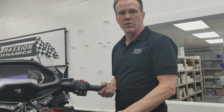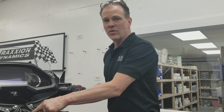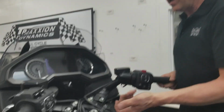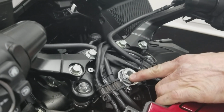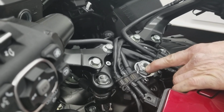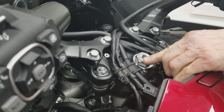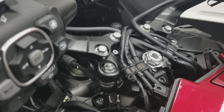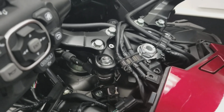This is what you'd have to do if you were not able to torque this crown nut. You'll see what we did here if you want to come closer. We got it as tight as it will go with a common 1/2-inch drive ratchet in the hand. And then we just put some marks, and we took a 1/2-inch drive air gun, 30mm socket, and just bumped it. We watched the marks move, and waited till the marks wanted to stop moving. So basically they had zeroed, and they weren't going to want to move anymore without really forcing the gun, so to speak.